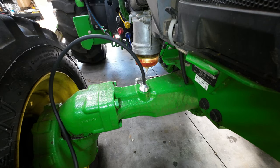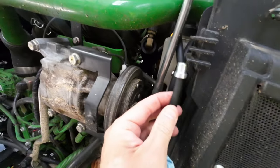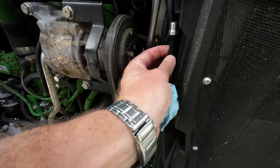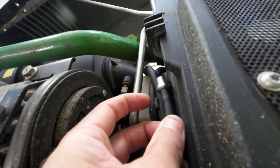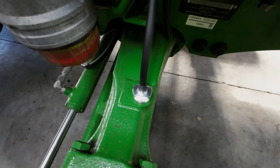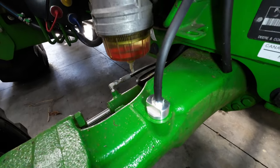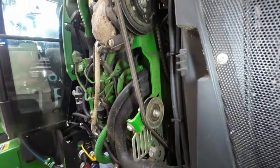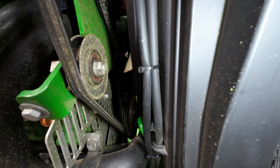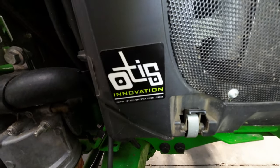They say you should have this vent anywhere inside the engine compartment that allows for clearance — if you go into water or anything, keep it out of the rain, and don't directly inject water up into it. So let me install this, get it cut to length. Here's the little vent installed. No clamp on there, so if it does pull off I can always reinstall it — goes up and behind this panel cover. I have it zip tied decently tight without snuffing the hose out. Nice and neat installation. You can get it from Otis Innovation.